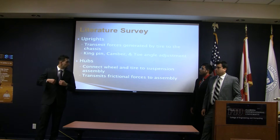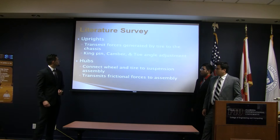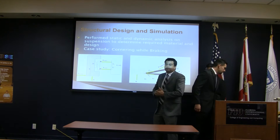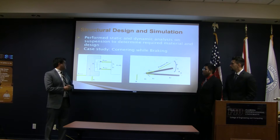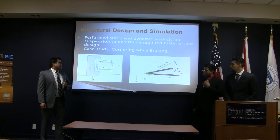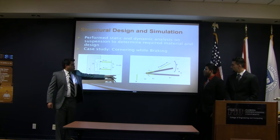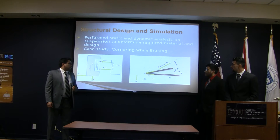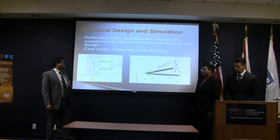The hubs transmit the loads from the wheel and rim over to the upright, which then transfers the forces to the chassis. We are doing analysis on the suspension forces. We've been doing static analysis — everything starts from the wheels. We have a normal force on each wheel and also a lateral friction force due to a curve. We've been analyzing the situation in an extreme case going past the curve, either accelerating or braking, which adds additional force — adding tension to the front of the lower arm and to the upper rear arm.